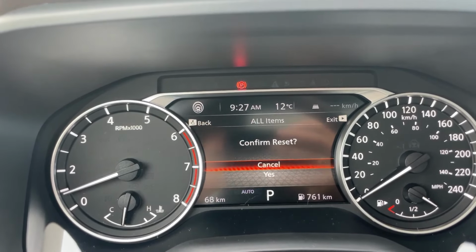So when you're bombing along, and especially if your cruise is set, you're most likely going to be down in this eco compression zone. And over here, it'll be down in this negative range. That means that you're on the lower end of your turbo and you're going to get phenomenal gas mileage. But when you need that extra power, all you got to do is push the gas pedal. And you're going to see this climb up above the 0. And once you get close to that 15 or even up to the 30, you're going to feel a huge boost in power. And on this side, it will put you right up into the power zone up here.